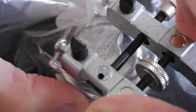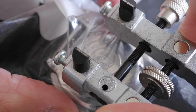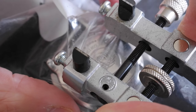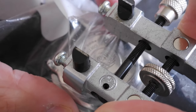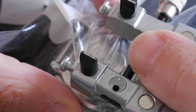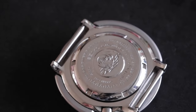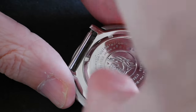I'm not going to take it completely off until I know I'm absolutely safe and it's definitely going to come off by hand. This is where I've made mistakes in the past - being careless and pulling the opener off at an angle and accidentally scratching the back. Once I know it's loose I'll lift it up vertically, loosen it a tiny bit more, and then we should be able to undo it by hand.